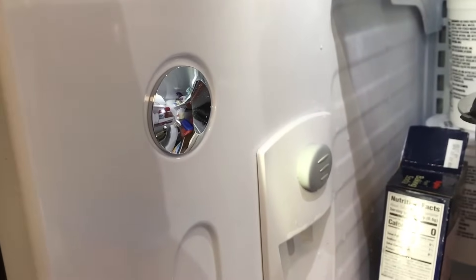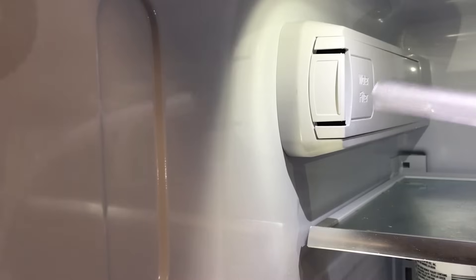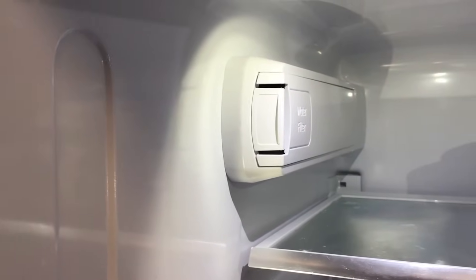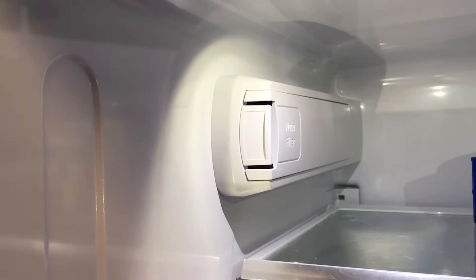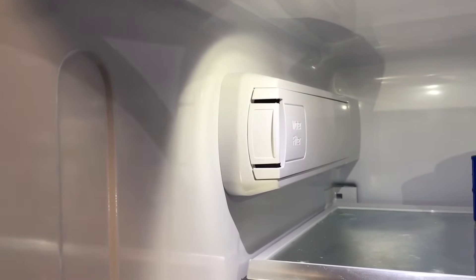It seems like this works — do this at your own risk. Another option is to put the bypass plug in and then put a filtration system prior to the fridge, like a whole-house system or inline filters. Another option is to pull the RFID off the bypass filter and attach it to your filter. Those are two different options. That's all for this video — if you have any questions, please leave them in the comments. If you like this video, please click like, and if you haven't subscribed I'd appreciate it. Thanks for watching — until next time, goodbye.